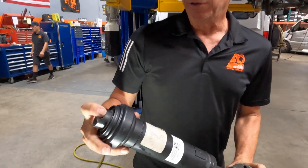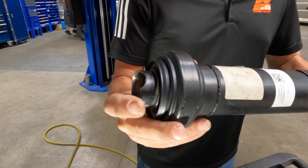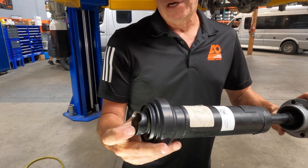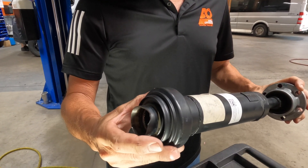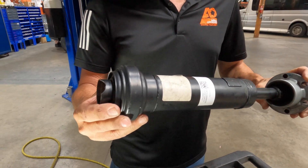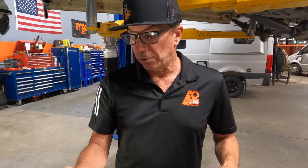You can actually see where this failed. What happened was it came out beyond the spline. We'll get you some better pictures of it when it's apart. But when the spline came out, it cocked in there and the van became literally undriveable at speed. Luckily it was pretty close by — they limped it in here at about two miles an hour.